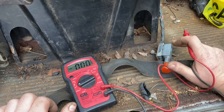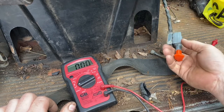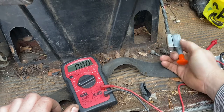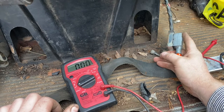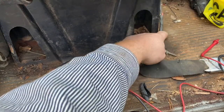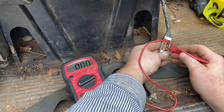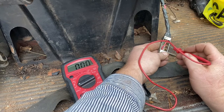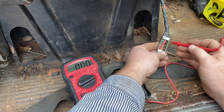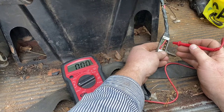Next stop on the wiring is the switch, and this is the switch that goes up there at the gear shift — should be up for high and down for low. We pulled the switch apart, which these things are real easy to come apart — they just snap, three lugs. The way this should be wired is you've got this red wire, which is the high-speed; you've got this green wire, which should be the hot coming in; and then this third lug down here is a black wire — it's the low-speed going out.